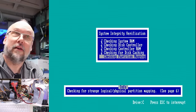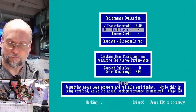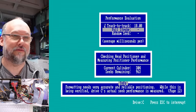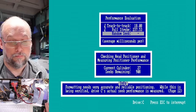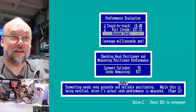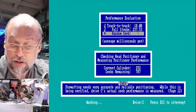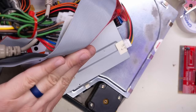I'm frankly shocked but then at the same time I'm not — Tandon makes really good stuff. Right now it is doing the complete seek back and forth and I can see the stepper motor going to the full extent. It's a slow seek time, but what's quite amazing is it's silent. Most of the time hard drives back in the day with the stepper motors did make quite a bit of noise with the seek. There's also an interesting data screen: drive RPM is just under 3600, MFM encoding, and notice the controller BIOS location is F000 — that's because this is using an AT BIOS in the actual system BIOS. Maximum data rate is 513,000 bits per second, so about 500K per second.